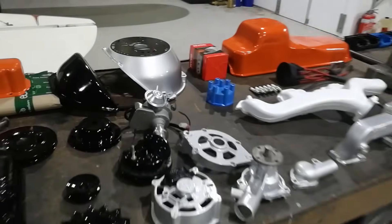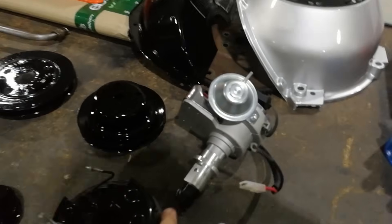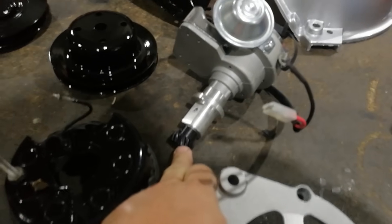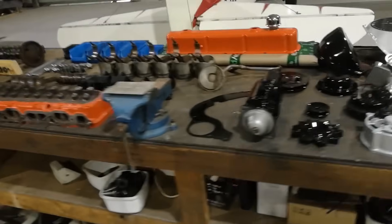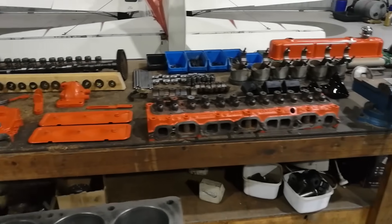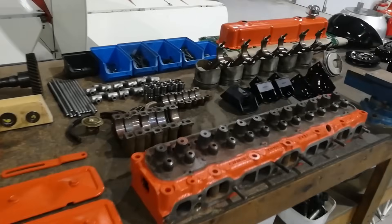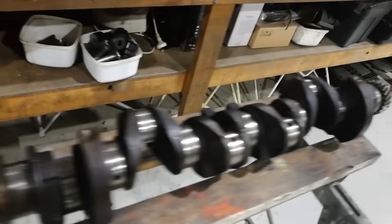The distributor drive was also a problem. This is a brand new electronic distributor I bought off eBay for about 150 bucks, but this gear on the old engine was plastic and it was stripped. I'm going to make the call that the original owner had a gutful of the water consumption, burning water, and also the fact that it quit on him once the distributor stopped driving. Otherwise the engine was pretty good - all the main bearings, big ends, and the crankshaft all check out nicely.